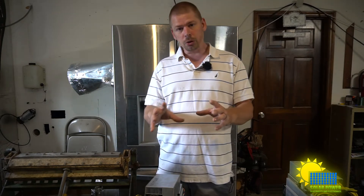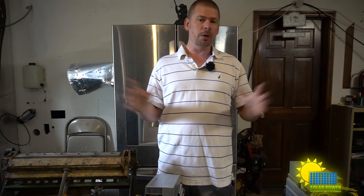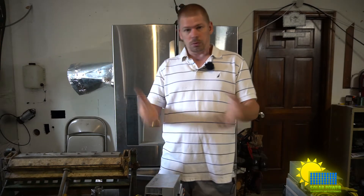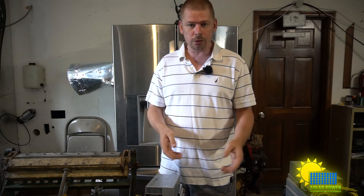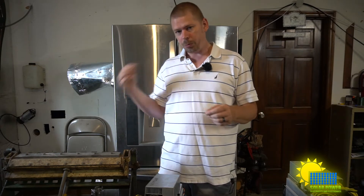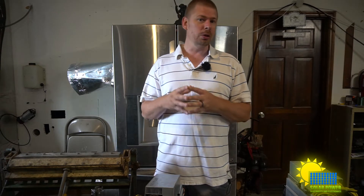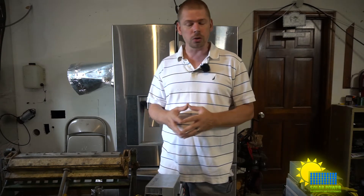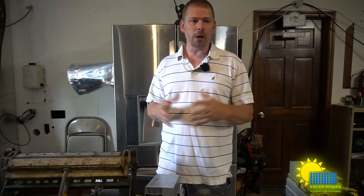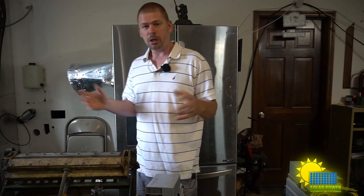What I did — and I have to say everybody should do this — you need to take it apart, take the fans off, take the covers off, and make sure it's cooled down to room temperature before you do this, because it will damage it if done at full capacity. Remove the covers on both sides, blow it out from the exhaust the other way, and peel the dust off the fan blades and the dust collected on the heatsinks. This one was full of dust — I went and did a reset on the software side, reprogrammed everything, and it works really well.